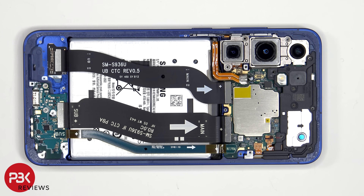However, it may be a little bit more difficult to reconnect the flex cable to the replacement screen when reapplying a new screen. The easier way would be to remove the backplate, then the bottom speaker assembly and the speaker assembly itself, giving access to this flex cable, at which point you can disconnect the flex cable from the screen, and then heat up the front of the phone where the screen is to loosen up the adhesive underneath and pry the old screen off.